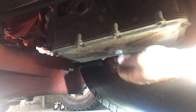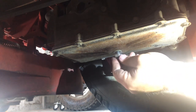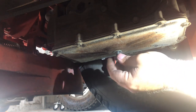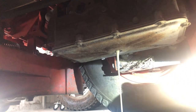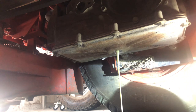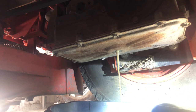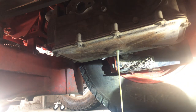This pan is real clean — I mean, it's got no debris in it. I want to see what the fluid looks like; I want to make sure nothing comes out in it. I bought this used. That fluid looks kind of milky — I don't know what's been put in there, but I'm going to change that out for sure. Maybe it got some water or something in it.